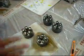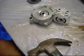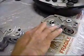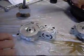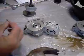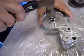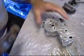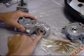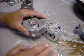We'll go ahead and start the reassembly. I had to remove the two spring pins from the old assembly and transfer them over to the new center case. It's simply a spring pin and I'm going to tap those in until it bottoms out. We're good to go other than the small pin for the freewheel mechanism and the washer on the back of the motor assembly.